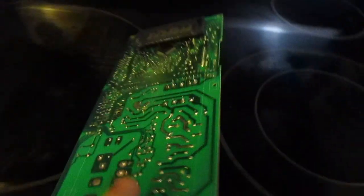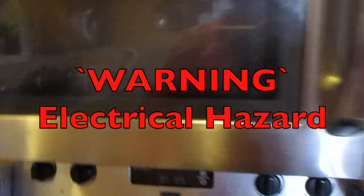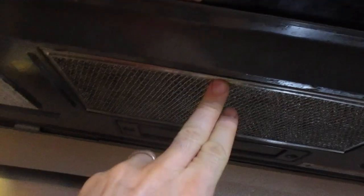We have a microwave here and as you can see the glass dish that's supposed to be rotating in there is not — it's just sitting there. What I've done is bought a new control board. Before I realized this was the problem, I went under the microwave and removed the motor underneath. I tested that motor and it spins independently, so the motor is working — it's not a motor issue, so it has to be this control board.